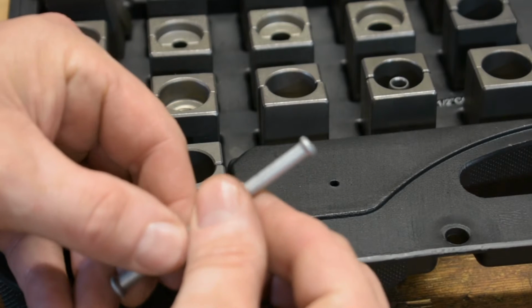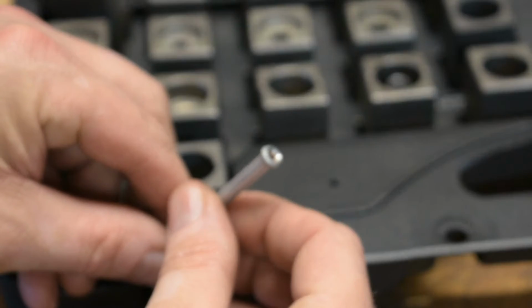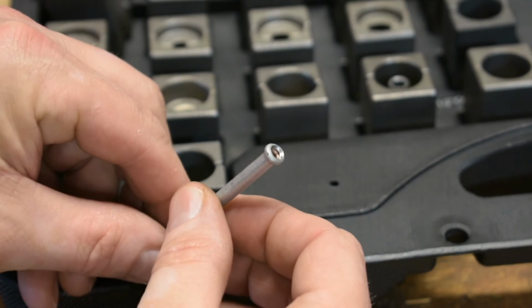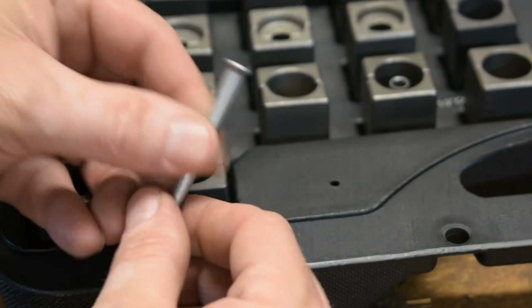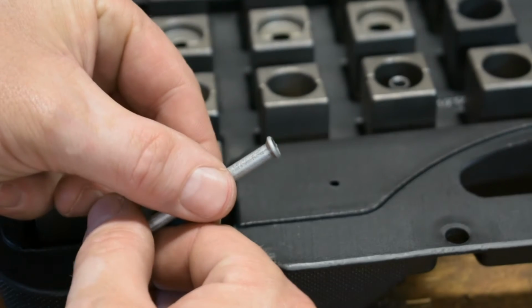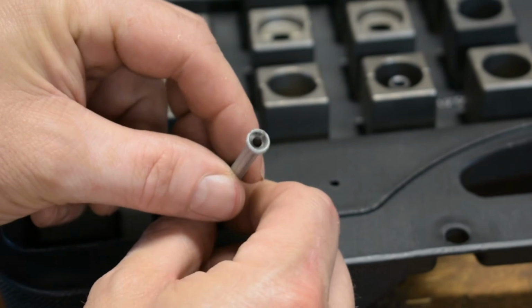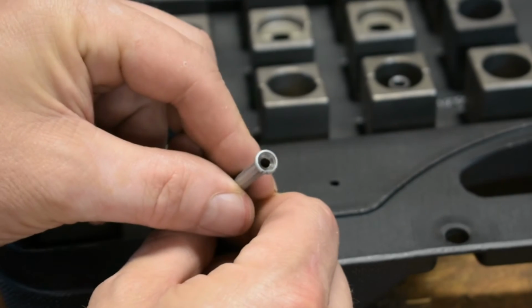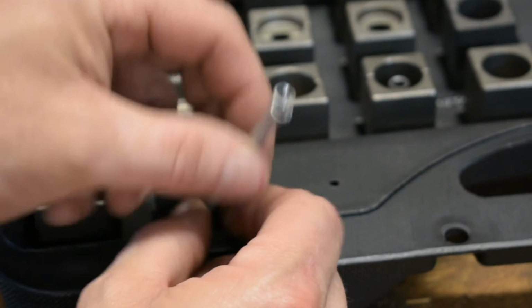It is going to take you a few times. Now, the first attempt that I had here, I did screw this up and did have it in there a little bit shifted. I think it's because I over-tightened on the cylinder and didn't go by feel. So you'll get a little bit of feel for it. It's not complicated, but it's going to take you a few times to get this right, and certainly it did for me too. But beautiful double flare.